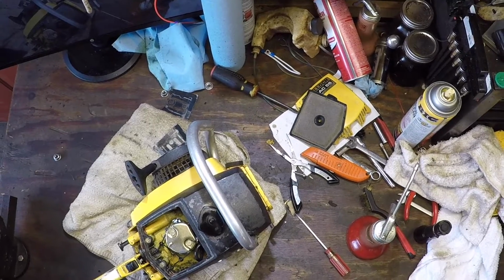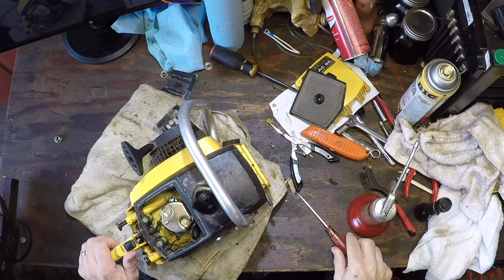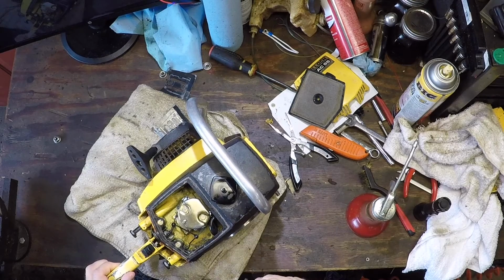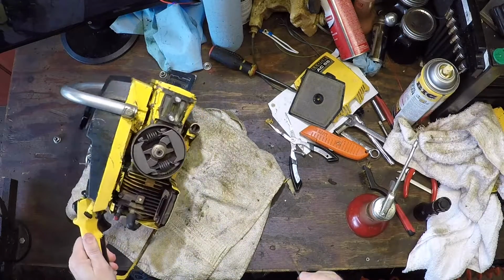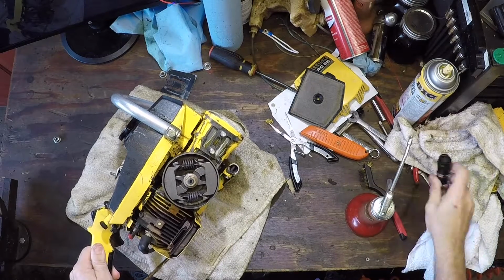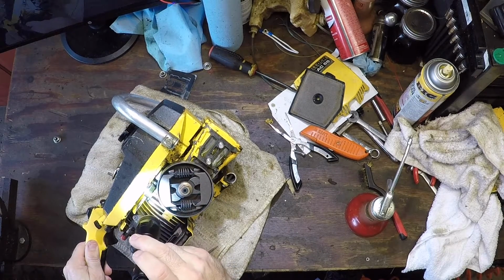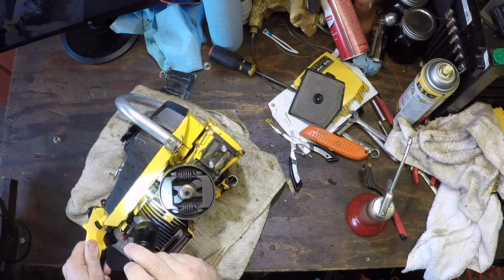Pretty pleased with this saw. Get anything on eBay, you kind of take your chances. But you guys heard before, it was sucking air like crazy. The two bolts that hold the tank to the body are loose, so it's sucking air through both sides. And if you look in here, let's see if we can get some light on the subject. Right in here. That's kind of the hard part when you get the tank to sit on top of the spacer and the gaskets. Sometimes they move forward, you crush them, you move them out, and it appears that's what's happened here.